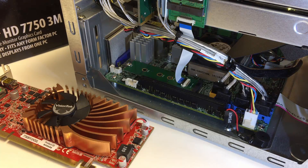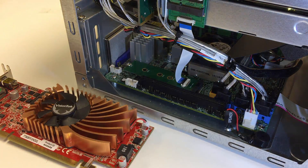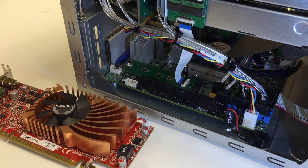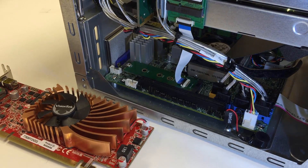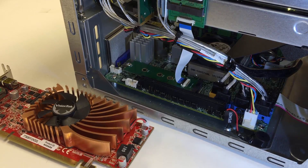Item two: keep in mind that you've got a screw right above the PCI backplate screw you're about to try to remove. So let's get a very long magnetic tip screwdriver right down in there, and we can take that PCI backplate out very quickly by just removing the screw. This is where the magnetic tip will come in handy to avoid dropping that anywhere.